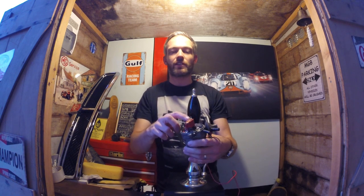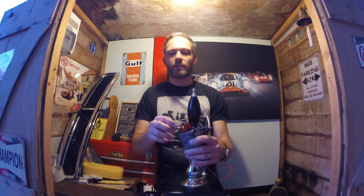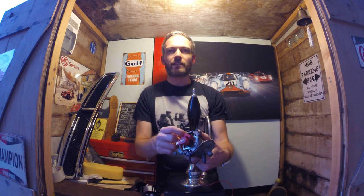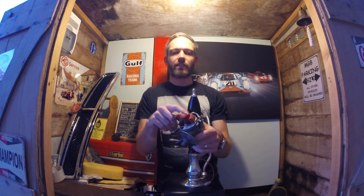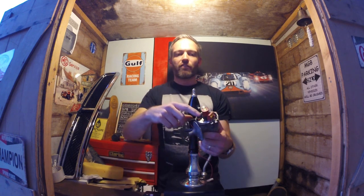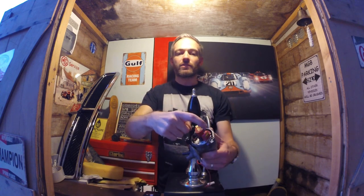The module reads the magnetic pulses — I think it's the Hall effect or something like that — and it knows when the lumps in the cam are coming round. This then determines when the coil should fire its high energy output. There are no moving parts in here, which means no wear, no servicing, and it's always in tune. Different systems exist — some use a fan-like disc that cuts through an optical beam inside the module.